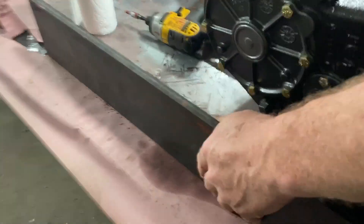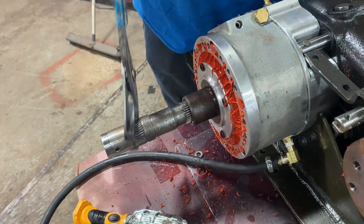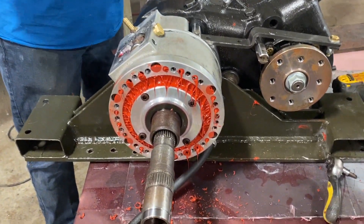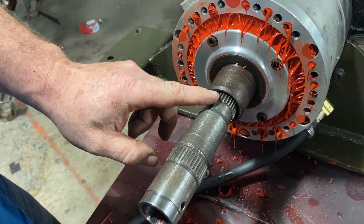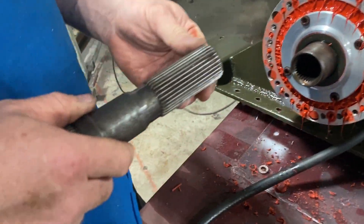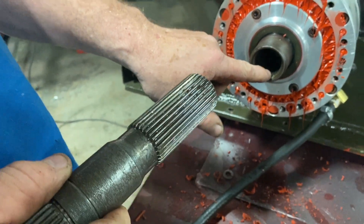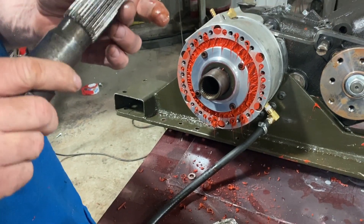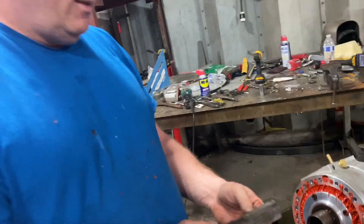On one side you put a block with a bolt to keep the output shaft from spinning, then you spin the input shaft. What happened was this female spline was worn out enough that the 31-spline would fit into it and it felt like a snug fit — but it's actually a 32-spline. This will not fit in a 32-spline that's not worn out, because there's only 0.010" difference between the outside diameter of this and the outside diameter of a Chevy spline.